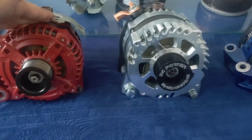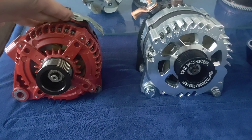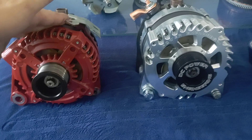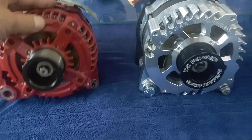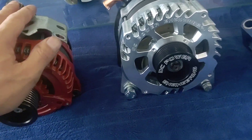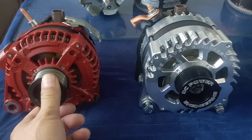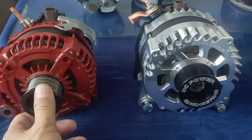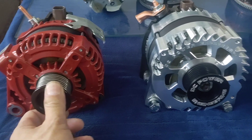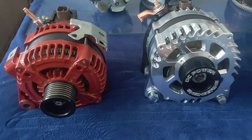It's a minute difference in the diameter — it looks about the same size almost. For sure the parts are different inside though. Small cases are 120 millimeters, 128 I believe, versus 138 for the large case. Pretty minimal amount of difference. But the rotor weight and the actual size of the stator on the outside makes a huge difference at idle especially.